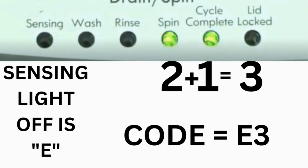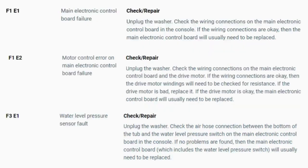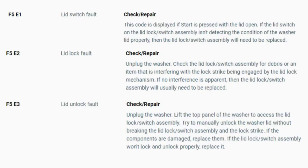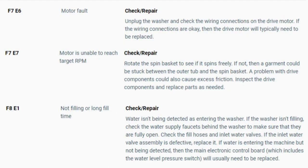Turn the dial again to see if you have any other codes; if there are no more codes, you're done. To exit diagnostic mode, turn the washer off. Now you have your error code — use the images in this video to look up your error codes, look in your washer repair manual, or just Google 'top load washer error code' and enter the code, and it should come up no problem. Now you know the problem and what's causing your washer to not work. Now it's time to find the parts needed fast and cheap. Watch our next video for the quick tutorial on how to do this. We'll see you next time.